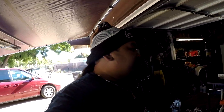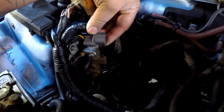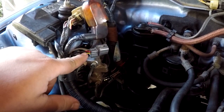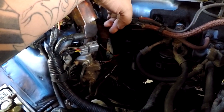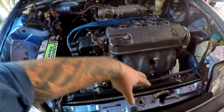I'm pretty prompt on replies because it goes straight to my phone. In today's video we are going to try to button up the car. I'm gonna head to the junkyard, grab the female end of this plug which is on the shock tower, because this is the original fuel injector wiring for the EG. You can already see I tugged the ECU on the inside of the car and it disconnected the plugs right here - lucky for me they're all labeled so I know where they go.